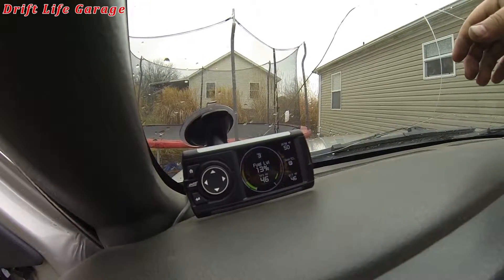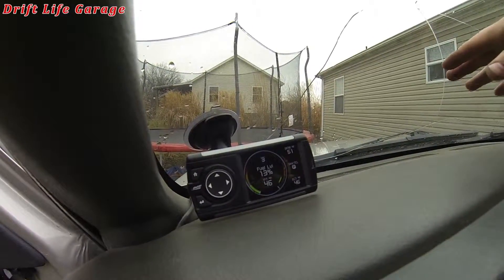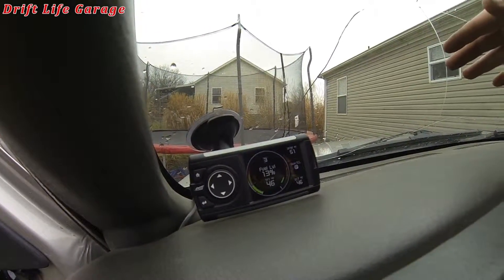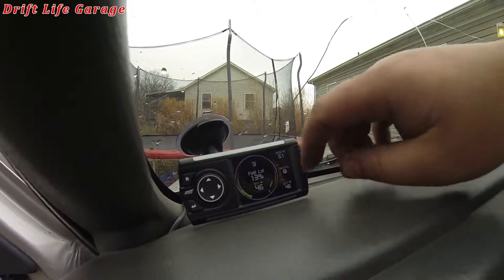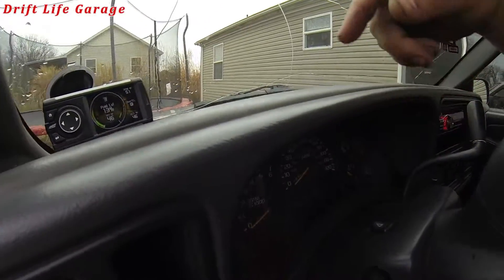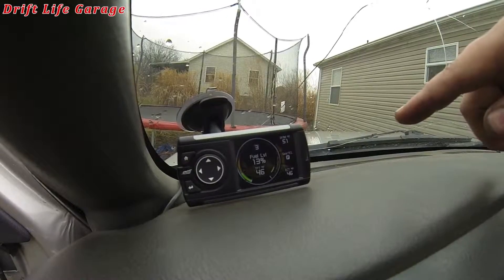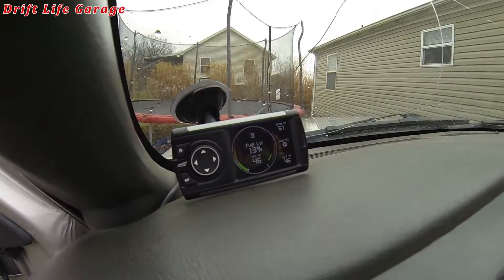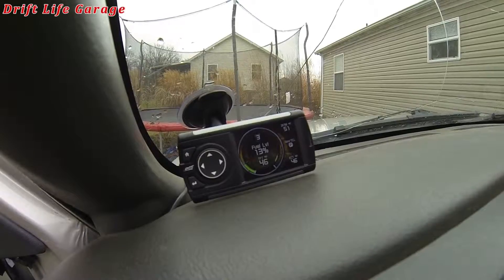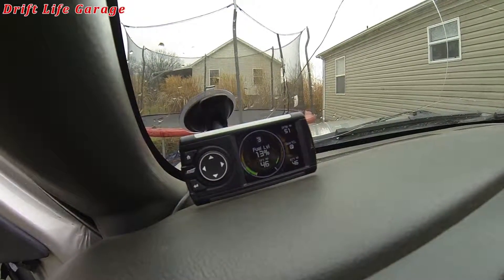It's definitely a good thing to have. I checked the air intake temp without the cold air and then with it — the cold air actually dropped the temperature about 15 to 20 degrees, which is pretty cool. This one is your gear shift indicator. On the gauge cluster it doesn't even work, but this tells you what gear you're in, when it shifts, and when the torque converter is locked. Down here is your coolant temp. The only thing it doesn't tell me is oil pressure — I might still fix the gauge cluster, I'm not sure.